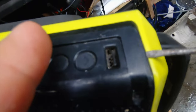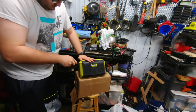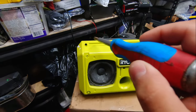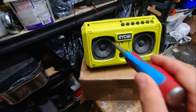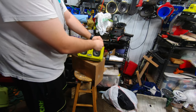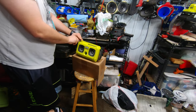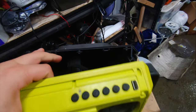Once you separate it, there are a few places where it clips in and then you can pull it out. The next step is there are a few screws around here that you need to take off to remove this faceplate. The speakers have some screws but I wouldn't worry about them now until you get the wires soldered off, and then you can worry about putting the new speakers in.